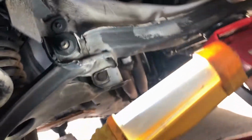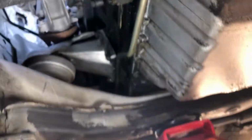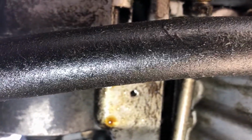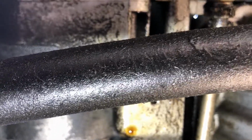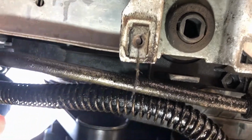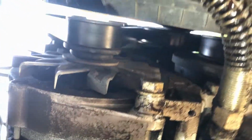There's the passenger side. Oh my God. So just doing an inspection first. So I see there's some oil right there. What is that? The alternator. Alternators don't leak oil. This transmission cooler line is pretty nasty. There's the drain right there for the radiator. So there's something up top there that's leaking there. Oil pan has a little drippage.